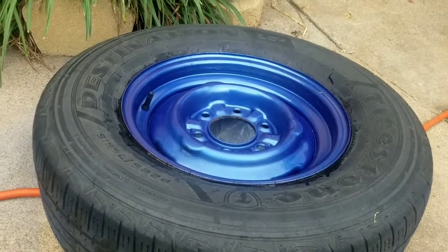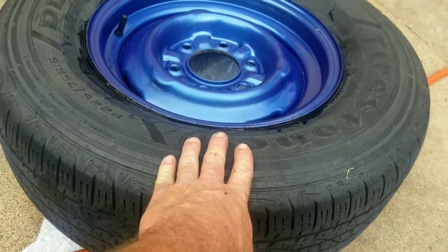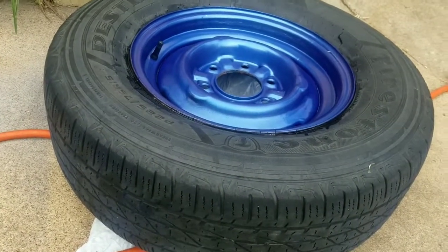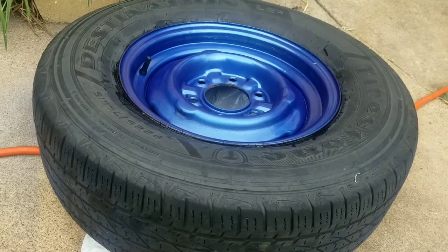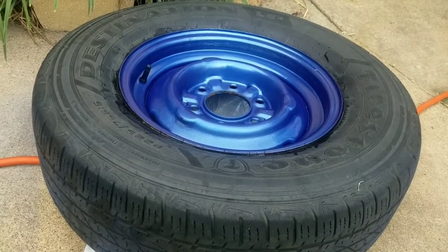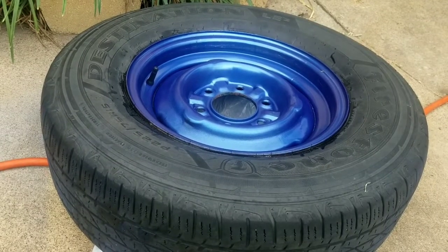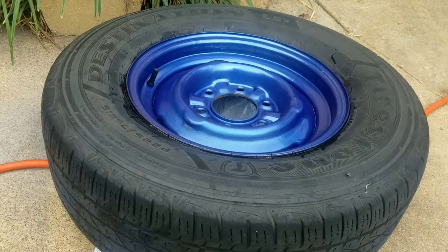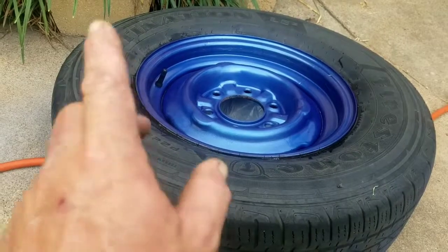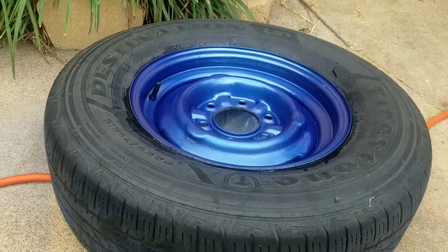There's a couple of home tricks you can do. You can take an old tire, put a 2x4, 2x6, 2x8, 2x12 right here, and drive up on it with a vehicle, and sometimes that pops it. You can use a bumper jack on an older vehicle, but you can't really use a bumper jack on newer vehicles because they have plastic bumpers. And if you're a pretty talented welder, you can weld you a deal and mount it in your shop on your wall and push down on these tires, and most of the time that'll pop them.